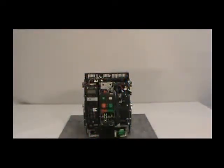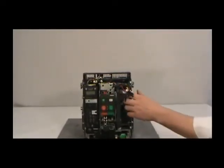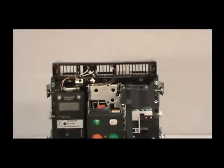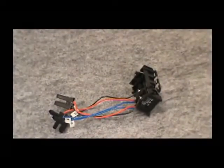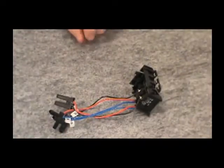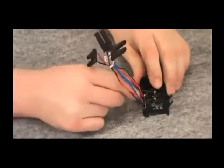Next, grab the right accessory tray with your thumb and index finger and slide it out. To remove an auxiliary switch, pull back on the switch's locking tab and tilt it backwards so the metal prong can be slid out from underneath the plastic tab.